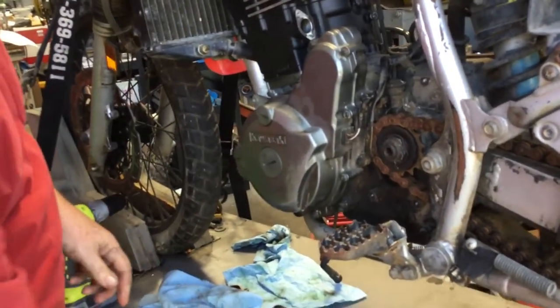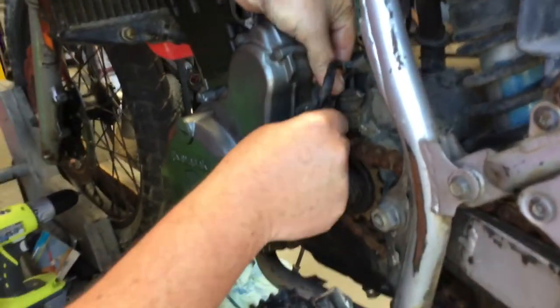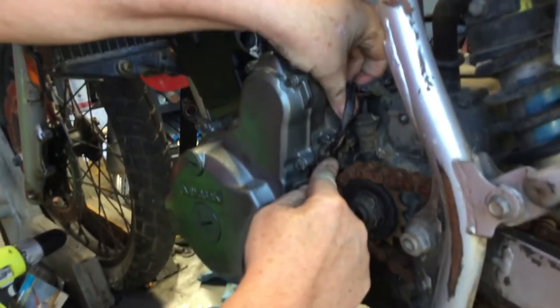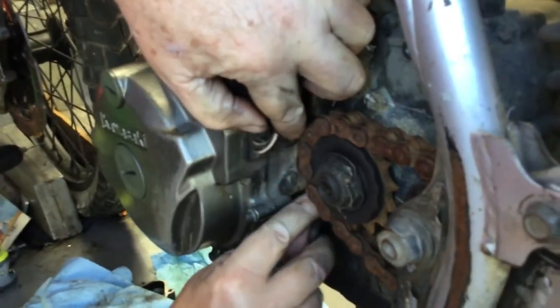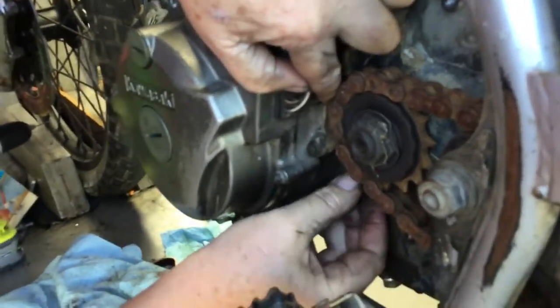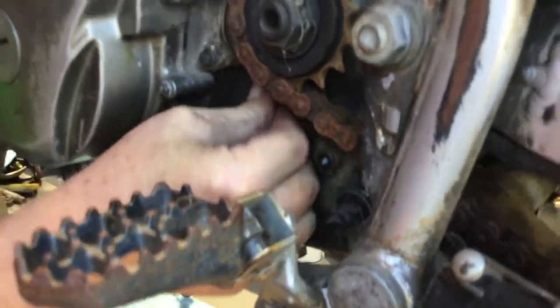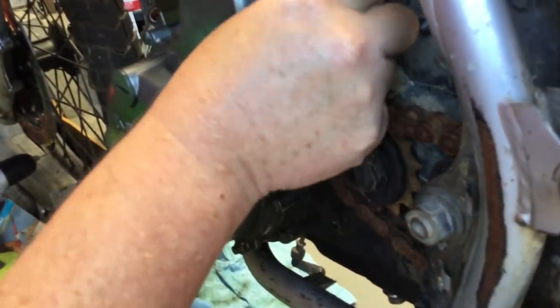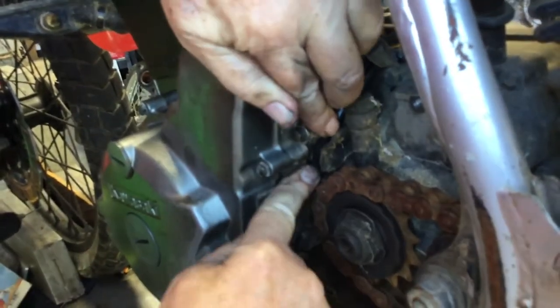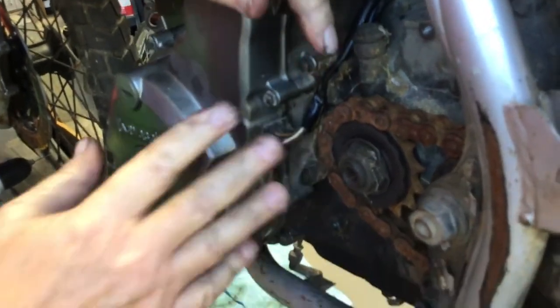Okay. So let's put our rubber plug back on there. Let's put our wires back in there. The ignition and neutral wire goes in first, and get it on the outside with the aluminum protrusions on the case. There we go. And then you can put this in there. Let's see. There we go. And then when you put your countershaft cover on there, you can be sure that all the wires are protected.